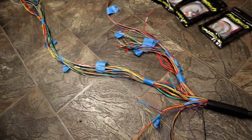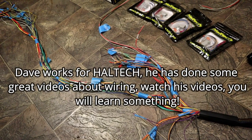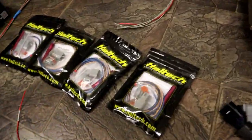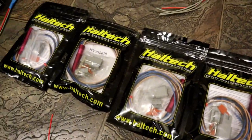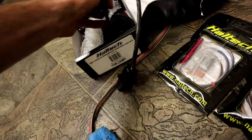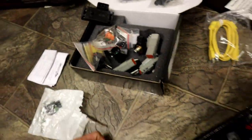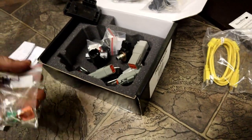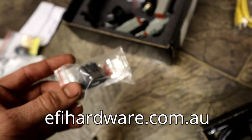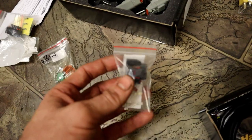I'm not going to go into detail of what I've done here as this is my first Haltech loom that I've wired up, but I'm going to put some links in the description to the YouTube page — there's Dave on there who does a lot of wiring videos and can explain things a lot better. I've also bought four wheel speed sensors and a single wideband controller kit to monitor air-fuel ratios. You can buy all these Toyota connectors from efihardware.com.au — it's better to buy new connectors with new pins and then they plug straight onto your factory stuff.